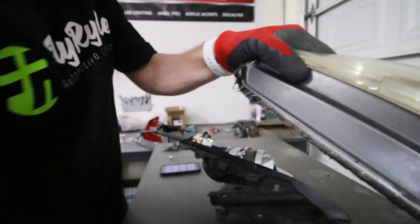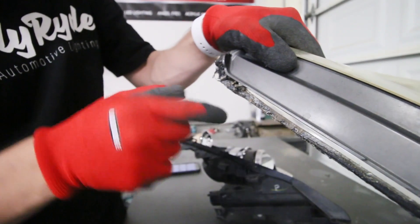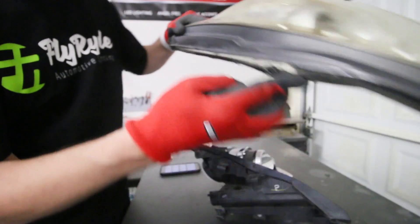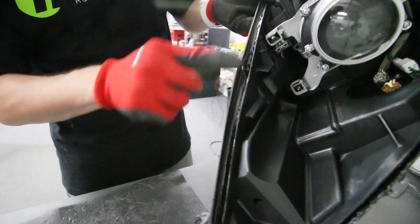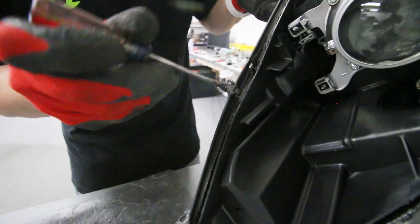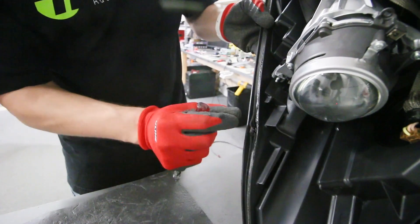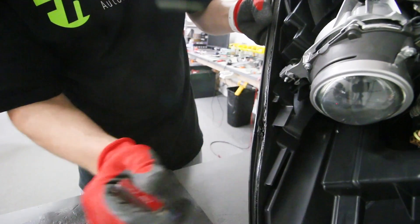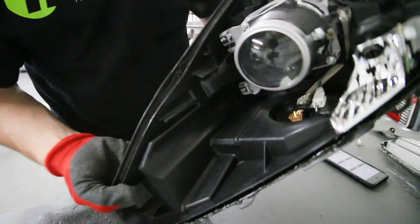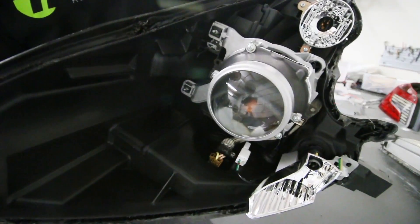Lenses off. Run your finger along the channel to clean it up. You can already see dirt that seeped in there — that means the seal was not super good, so I'll want to get all that dirt pulled off and then add new sealant to the channel, which is the area all the way around where the headlight lens sits. If you pry with a screwdriver you create bumps, the sealant won't have a flat surface, and you'll get air pockets — which can lead to leaking. Fortunately the inside of this housing looks great and has never leaked.